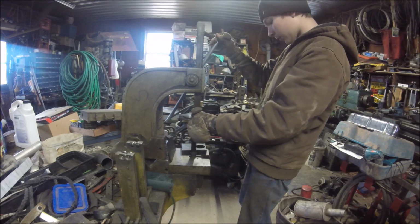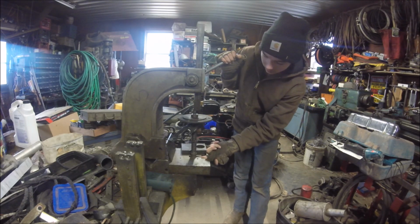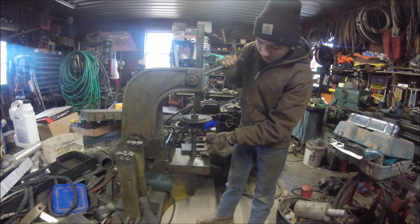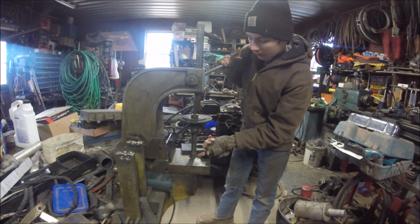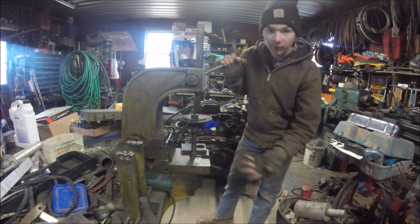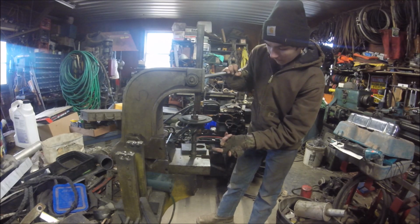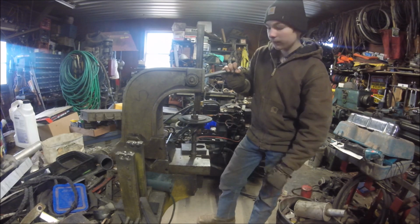Okay, so there's a little pin at the end of the shaft, not the drive shaft, the spring. What am I thinking? At the spring here. That's what the spring rides on. And you have to take that, you put it in your press, or whatever you want to use to depress the spring here. And then you just push down on it, get that spring loosened up, freed up there. And then basically just try to beat it out.